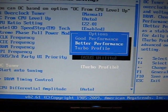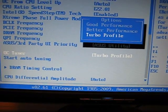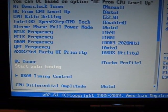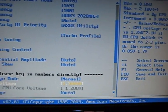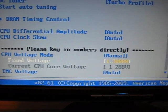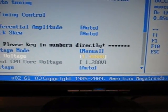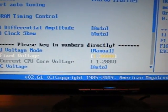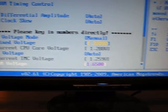If I had made another profile, I could have saved it and loaded it from the BIOS rather than having to load it from Windows — it lets me load it a little bit earlier. I can also start auto-tuning from the BIOS, which is something brand new that wasn't there before. They also changed the voltage display so that instead of showing what you've changed it by, it now shows what it's currently set at — basically the ceiling it will allow you to reach. I personally like this better than trying to guess and check what the voltage will be set at; it makes things a lot easier.